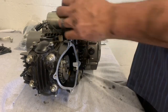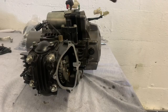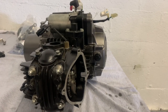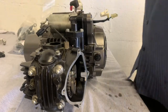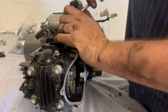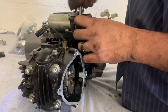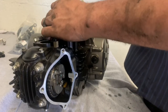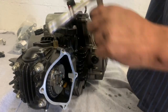I'm gonna spin this off, because when I go back together and set the timing, I have to go right inside that little hole right there — I have to go right down that little hole and there's a little line. Stick a little flathead down there and I adjust it back to pull the tension out of it. Pull the bolts out of the slack tensioner for the timing chain. You'll watch it — it'll start lifting itself up, and I'll just leave that loose.